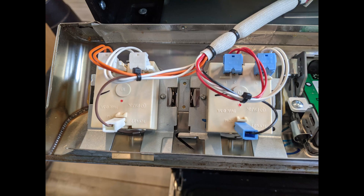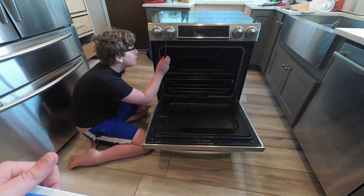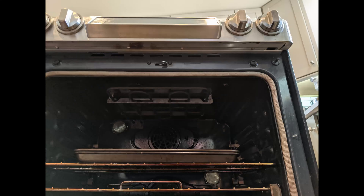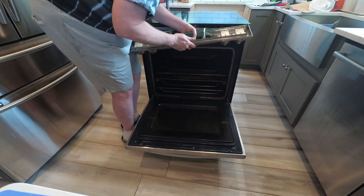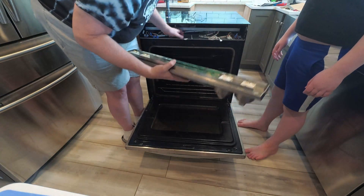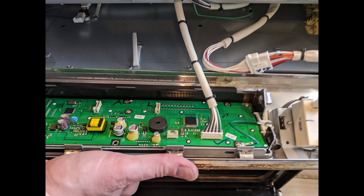The control panel has many cables connecting it, but you may be able to carefully lift and rotate the control panel so it can sit on the cooktop. I just held it while I photographed it and unplugged the cables from the controls. Open the oven door and you may want to place a pan sheet covering the gap between the oven door and the oven cavity in case you drop any screws. Under the control panel are four screws — remove them. Then the control panel swings up and can be removed. You can either unplug the cables from the dials, or further up those cable groupings is a large connector for each pair of controls — I'd recommend unplugging the connectors at that location because it's easier to reconnect them. Take photos if you disconnect at the dial so you can refer to them for reassembly.